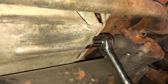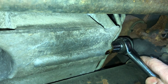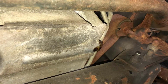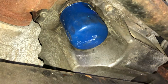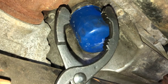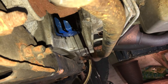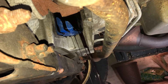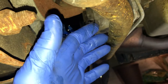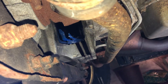After your oil is completely drained, go ahead and pop your drain plug back on and put your socket and ratchet on and just snug it up nice. You don't want to over-torque that drain plug because if it strips, you're going to have problems. Next is your oil filter — you might be able to get this out by gripping and ripping it by hand, but if you can't, use an oil filter wrench. I got this one at Harbor Freight for like six or seven bucks. This thing is putting out a lot of oil right after I cracked it, so just crack it, let all that drain off, and then with a rubber glove on for protection, take it off once the oil has stopped dripping.